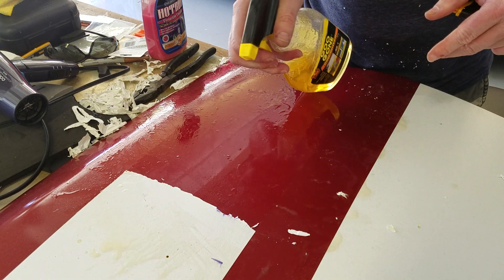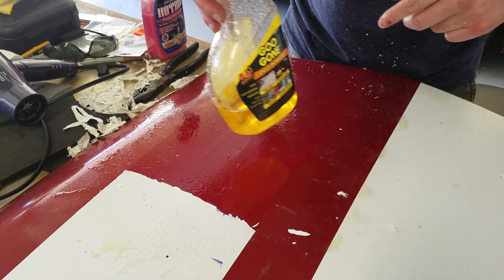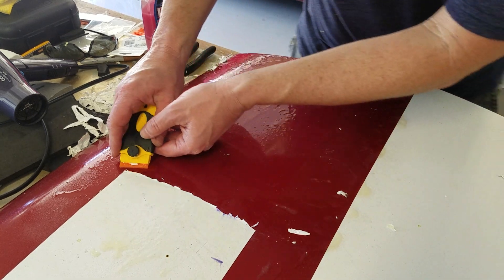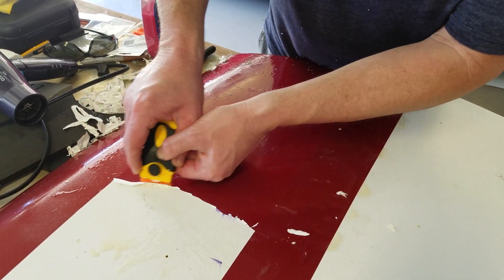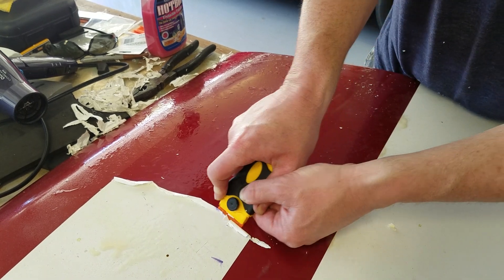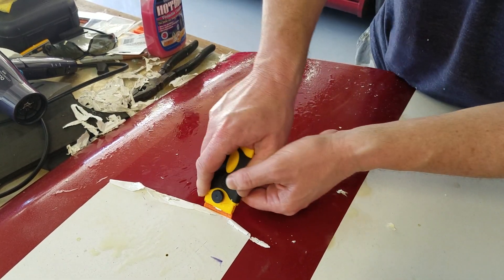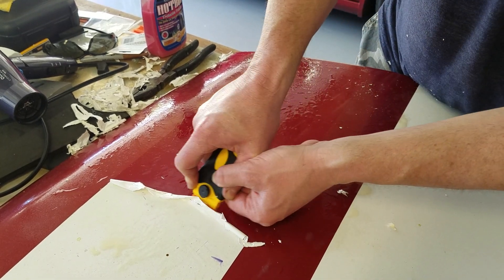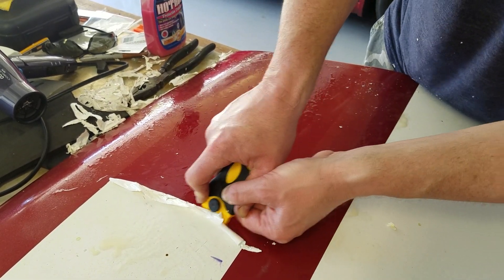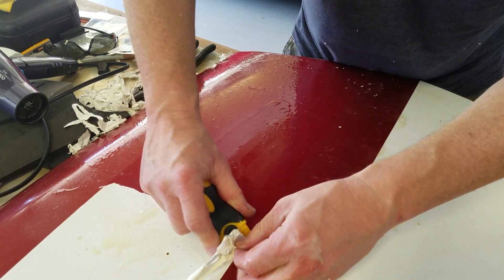It's kind of dried out, but along my way here I've been shooting a little bit of Goo Gone on it. I went through most of this bottle just on the short areas I've done so far on the car, so I'll have to pick up another bottle to do the rest. I've got some heat on it and you can see I just work it out. It takes a while — I've made these little stage marks on it, which helps me show my progress and keeps me focused. You get about a half inch to three-quarters of an inch at a time, then it starts cooling off and you have to reintroduce some more heat.